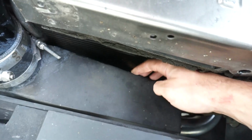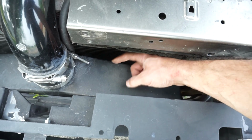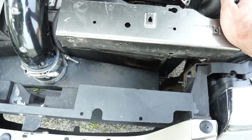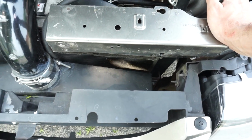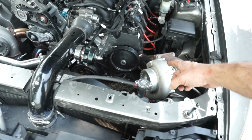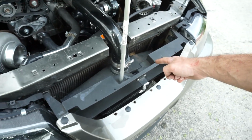So I told him to drop it back off here and I would look at it and see what's going on. And I found a problem. I looked down here. It's a little hard to see on this angle, but this intercooler ended up cracking from here all the way up to here, on the backside. So sometime between the dyno and now, that thing blew apart, because it was making like 10.5 pounds on the dyno, and then when he was driving around ripping on it a little bit, it just started making less and less boost. At the track it was making 6, on the street it was making 6, and then it seemed like it was making less. Added the second spring to the wastegates and then it barely came up, so we knew there was a problem. So found that big crack. I'm going to pull this thing off and try to weld it, and we'll go from there.